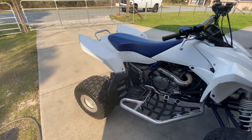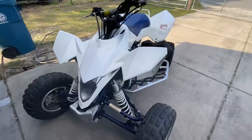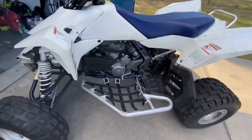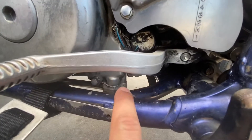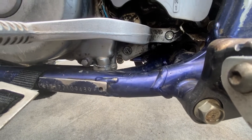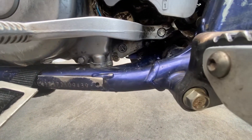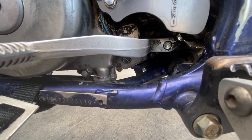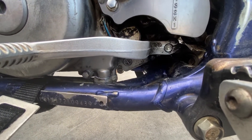Wheels are pretty clean but we're still going to hit those. Overall, not a bad machine. We also have this oil leak here — looks like somebody was already in there. That main oil line going in is leaking pretty good, so we're going to pull that. There's a bolt right under here — we'll pull that off and see if there's an O-ring in there. If it's shot, we'll replace it and probably put some RTV on there to seal it back up.